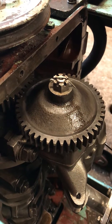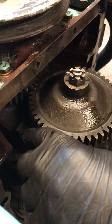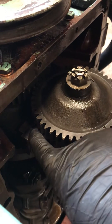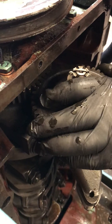It's a little bit of simple information but can save you a lot of money when you rebuild the engines, because you may need to add or subtract shims from between the pump body casting and the main cap. They just go in there — where my finger's pointing — you can probably just see a silver line. Those are the shims, so this is just a little bit of helpful information.